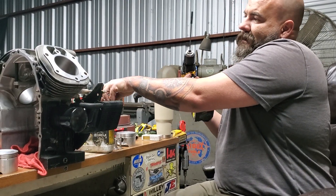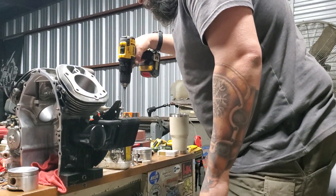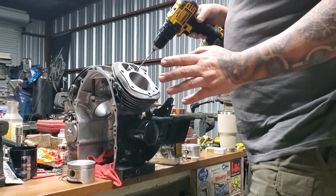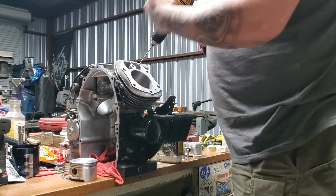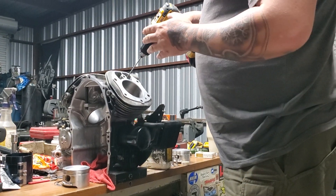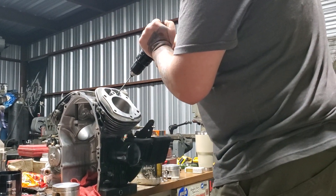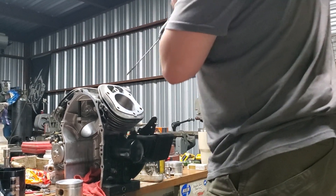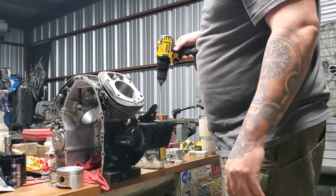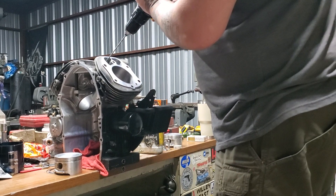I dip about half of the brush in the oil and let it drip off. If the tappet was spinning before, we're going to do 12 strokes — basically a crosshatch like we're doing the cylinder walls. If it's a non-spin tappet, I do about 20 strokes. That was 12 — if you want to go back and count, you can. It's not much, just enough. We're not trying to remove any metal, we're just trying to freshen it up. I re-dipped half of my ball hone.